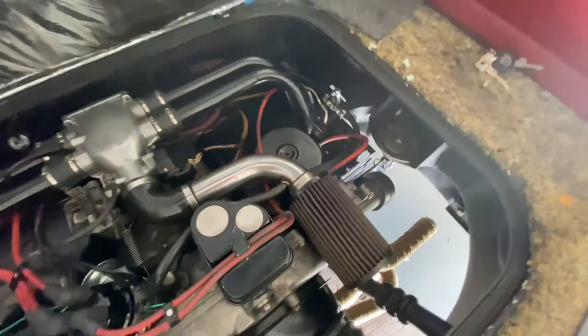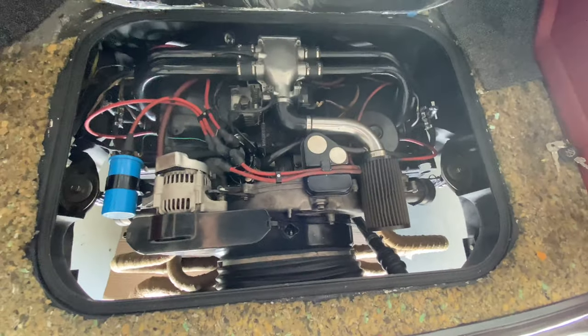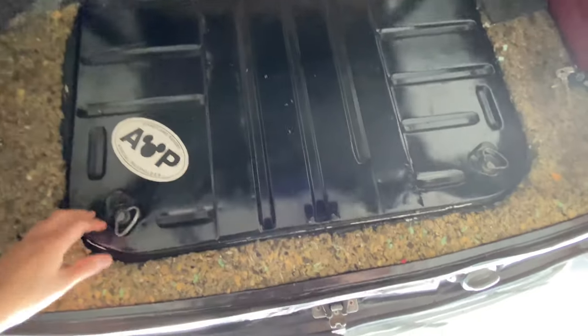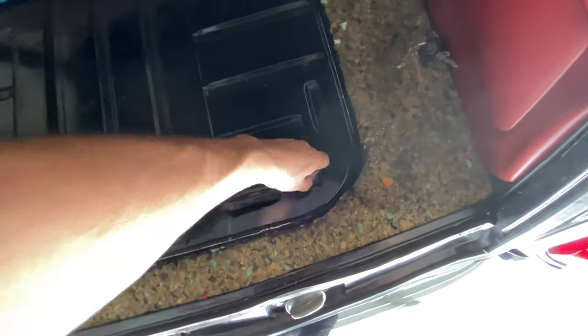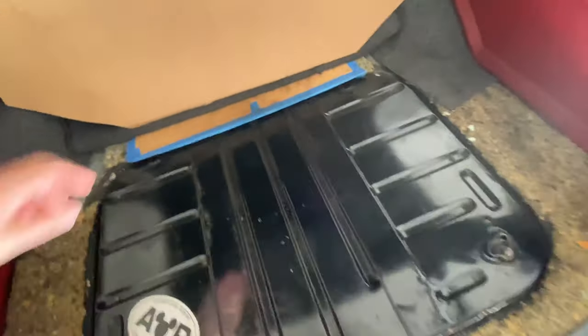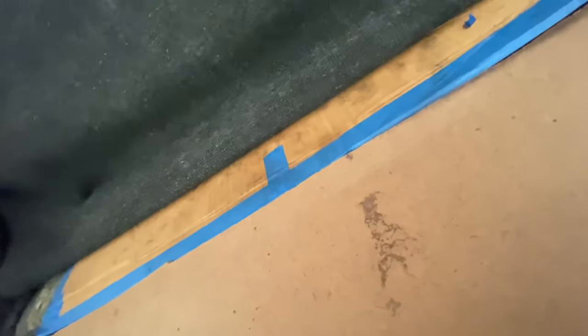The engine bay itself was seam shaved. There you could see where the original intake port would have been, and it was converted to an alternator. Being a California car, the heater tubes were also swapped out for J-tubes, and the engine mounts were converted to Porsche 911 engine mounts. The original Type 3 engine mounts for the automatic transmission cars are getting exceedingly rare to find, and unfortunately, I couldn't find any, and I thought it would be easier to just swap them over to the Porsche mounts.